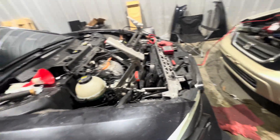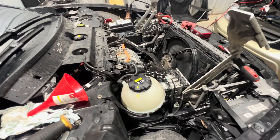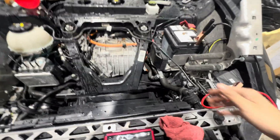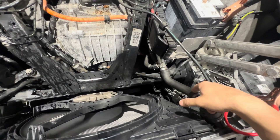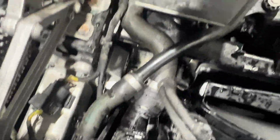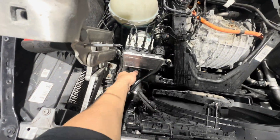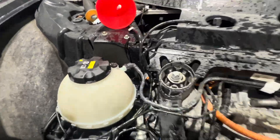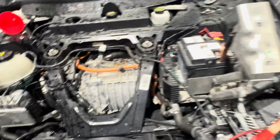It's going to make a mess, so make sure you have pans under the car — but it is worth it and you won't have to deal with this headache of a system. Turn the vehicle on and let it run and get hot. While you do that, you're going to want to massage — careful, it's hot, don't touch it when it's hot — but massage both of these coolant hoses here. Just keep pressing them in and out, and you will see air coming out of this little hole, the bleeder screw. Keep doing that until no air comes out.